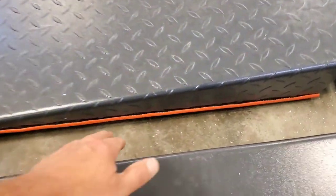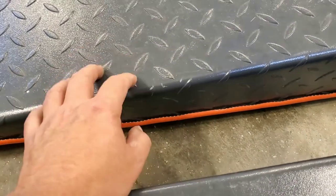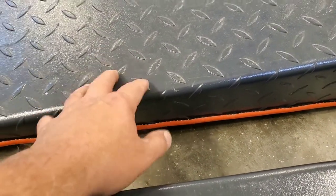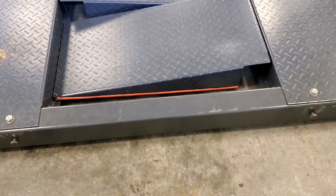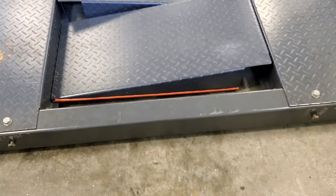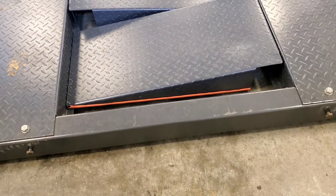After the first couple of years, I discovered that my ramps were actually starting to cause a little damage on my garage floor — you can see here where the ramp would sit. It would rock and it's slowly making marks in the floor. What I did to prevent that was put this orange fuel line on the edge of the ramp, which helps cushion the ramps as the car is coming up and onto the lift. I have to replace that fuel line every once in a while — every three years or so — but it's been a pretty good solution.